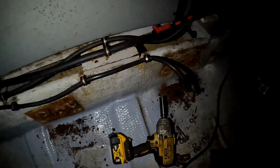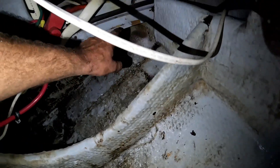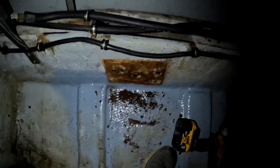It's not the worst it can be, but it's definitely a setback and I do not like it. I'm gonna have to do some research and see if there's something I can do to maybe fill it with something. I drilled a bunch of holes in the stringers all over the place. Basically what I found is this stringer all the way up past the cross stringer, all the way up to the front part, just past this motor mount — this section all the way up to this bulkhead is probably where I'm going to go. It is completely rotten. There's no wood in this at all.